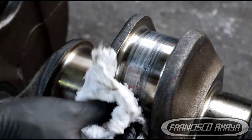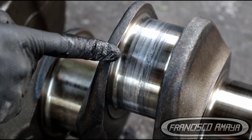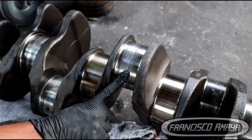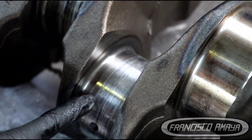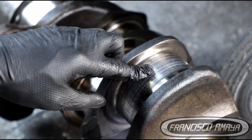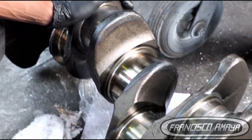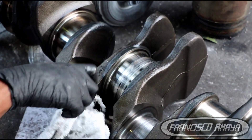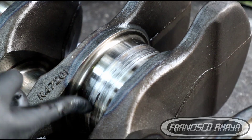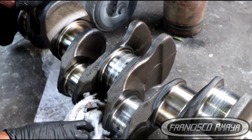You can see the damage on the crankshaft clearly. This is how a good crankshaft should look, and this is how a damaged one looks. It's not only one — there's one rod bearing that spun, another one here, and another one. In total we have three rod bearings that were damaged due to lack of lubrication from the suction manifold failure. The major problem is right here on the main bearing — it got damaged too. It spun, and that's why we cannot reuse the crankshaft.